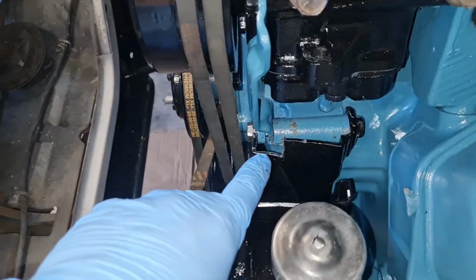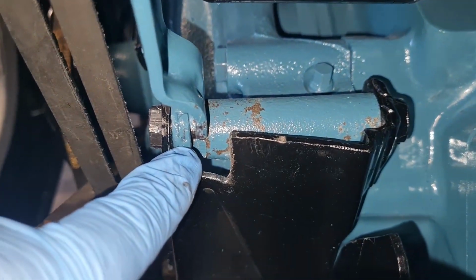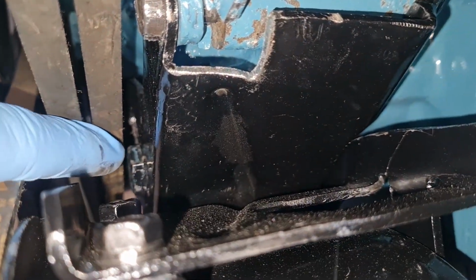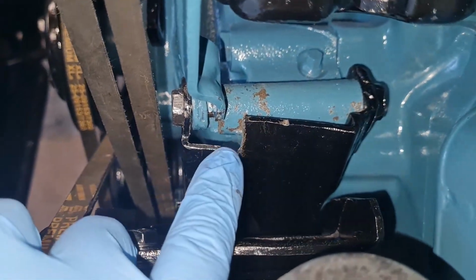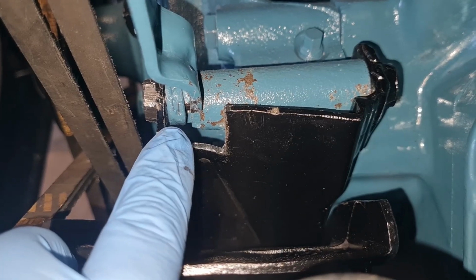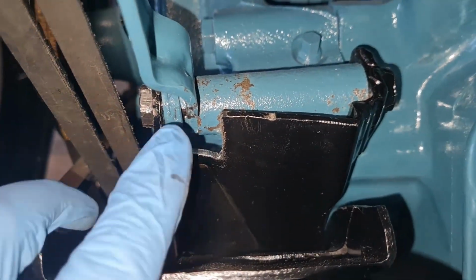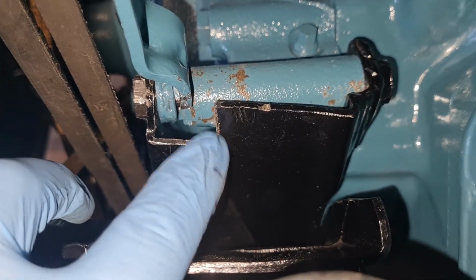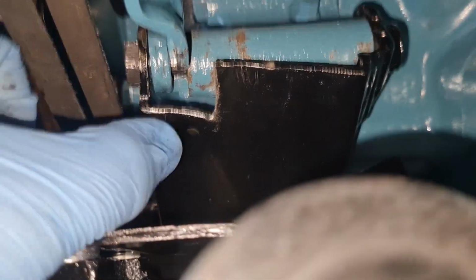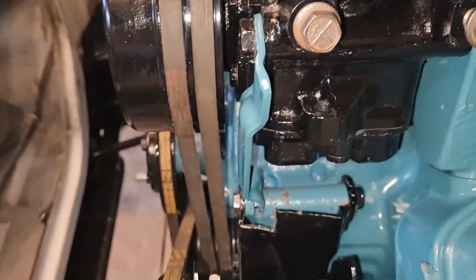Okay, a couple of days later. Right, the power steering is now done. I can't remember if I said, but I welded three washers together. I've done it twice, once there and then once down behind the adjustment bolt, because by moving this over by 3/8 of an inch, you now have that 3/8 that you've got to take up. So that's what that was for. I also had to cut this piece out here, because this continued over to about here and was knocking against the bracket for the aircon. Not that it works, but hey, it is what it is. So that's that done.